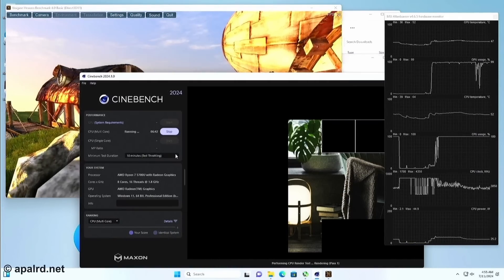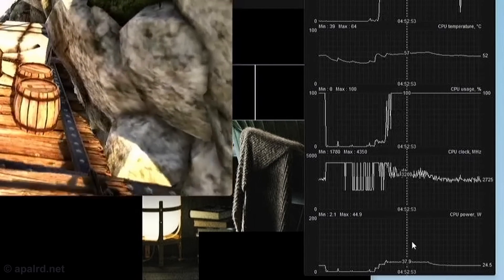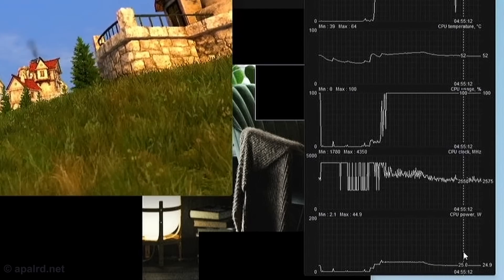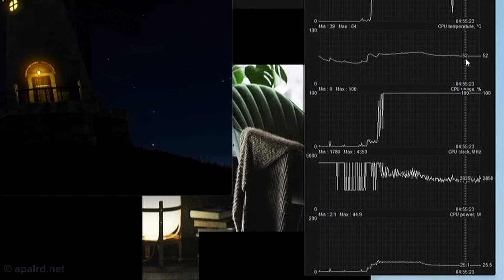After about 4 minutes of combined CPU and GPU load, it hit a 35-watt power target briefly, then dropped back to 25 watts with core clocks reducing to hold that limit — even though temperatures were only around 52 degrees Celsius, well short of any thermal limit. This behavior seems copied from a laptop profile: laptops are concerned with long-term power limits for battery life and surface temperature safety. The cooling solution here is more than adequate; the unit is just being artificially limited.